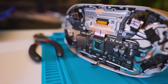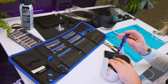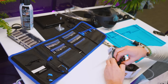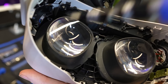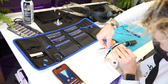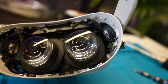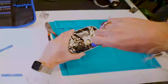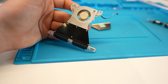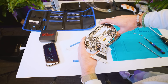The next challenge is actually taking the headset apart. Turns out you can completely crack open a Quest 2 with a cheap set of tools in about 5 or 10 minutes. It's remarkably simple. I tried to follow the only video on the internet that does a teardown, but I didn't even need it. Six screws on the inside hold the facial interface plastic — be careful because there's a fragile ribbon cable for the proximity sensor you'll have to unhook. After that, a few more screws hold the faceplate on, and then you can just pry the entire faceplate off the Quest. There's not a centimeter inside that doesn't have something important. Mr. Carmack, I see exactly what you're talking about regarding cooling — this teeny tiny little fan is the only thing cooling the Quest 2, and we're about to change that. A few more screws to remove the bracket, then unscrew the fan and heatsink assembly. And there you go — that's the XR2 right there.